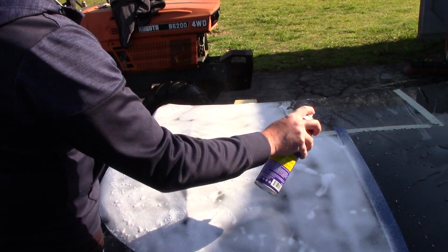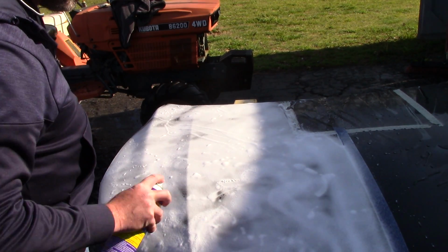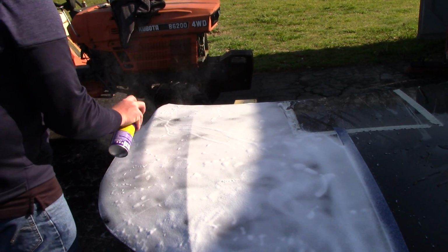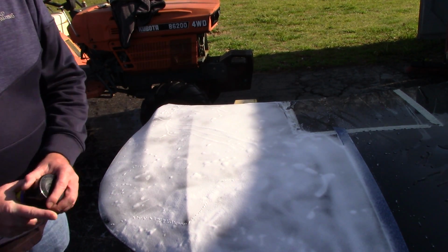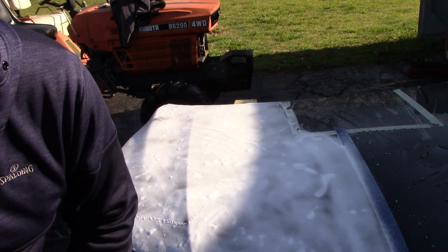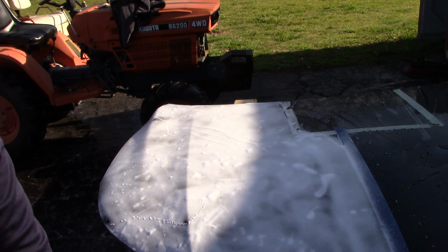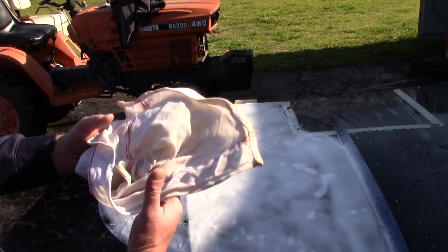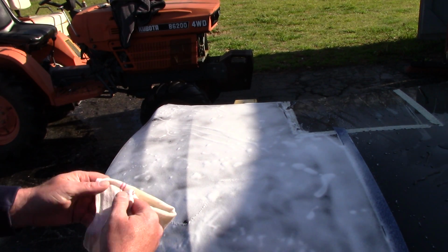Apply it at full strength, out of direct sunlight, and let it cure for 12 hours. You'll have a sealant that will blow your mind, but you've got to get over the fact that it doesn't bead water like a lot of protectants do on the market right now, because they're just filled with silicone. Silicone does not have the chemical resistancy of true silica.